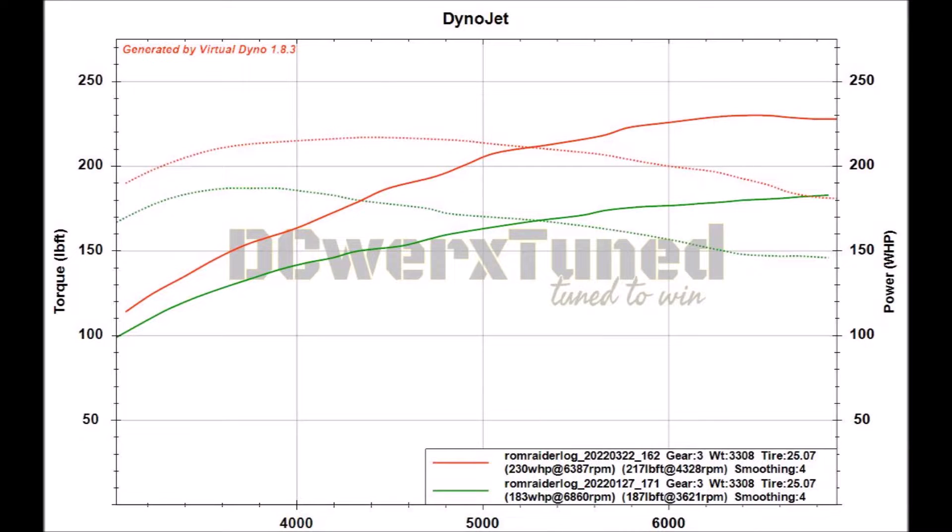So why would I want to do this, and what are the gains? For most cars, some more than others, there are big gains and small gains. In my car, from factory, I used Virtual Dyno — you can look that up, it's a piece of software that mimics dyno results and is usually very accurate. With the completely factory tune, the car was driving very horribly because it was pulling timing since it was picking up knock on our poor fuel, and the car made about 183 horsepower. I'll put the graph up now to show what it actually made after a reflash.